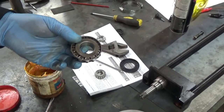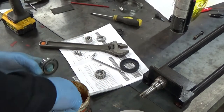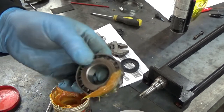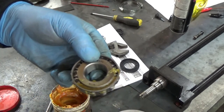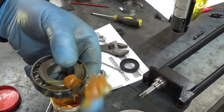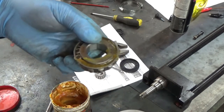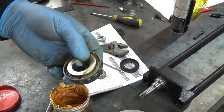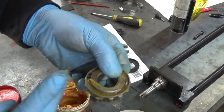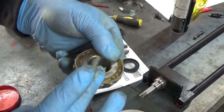Right, grease — I'm not going to pack my hands. One finger spread into the gap, force it in, spread back into the gap and force it in again. There's a feeling to this; you get the feel for it. You put it in and force it into the gap. Notice how little amount of grease I've got out of the chamber to do this — I haven't filled my hand with it and stuck it back in afterwards, which is a really bad practice. I've got out just the right amount required, and you just keep wiping it in, forcing it through the gaps.